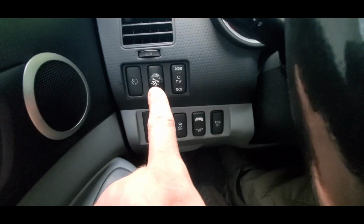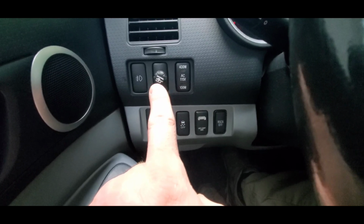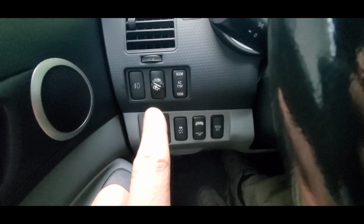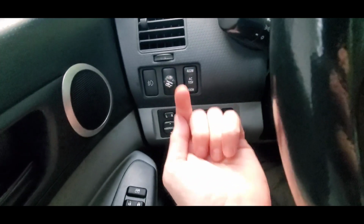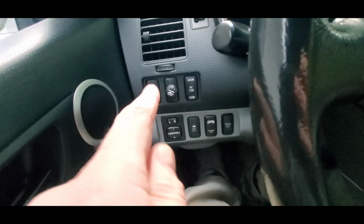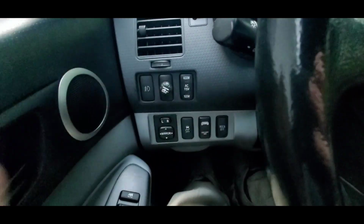You saw that I took the little Ethernet-looking cable that goes to the switch, and I actually just pushed it in from this side after I took the button out. That's way easier than trying to fish something up from the inside. You could also take an old clothes hanger, stick it down in there, wrap it around the wire, and then pull the wire up through. Other than it being tight around the emergency brake, it's a little bit easier if you release the emergency brake to work behind it, and then push it back down so you can work in front of it.